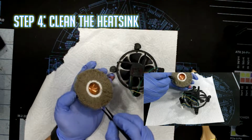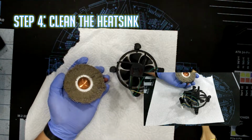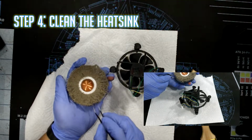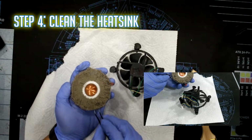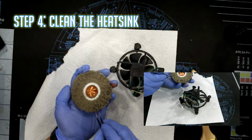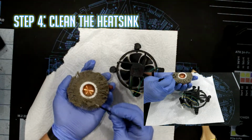Step 4. Clean the heatsink. First remove the dust with a brush or dry cloth, then treat it with compressed air, and then finish it off with a cloth and alcohol. And if you're wondering why I haven't dunked the heatsink in water, it's because dust is much harder to clean when it's wet. Plus, we don't have to wait for it to dry before mounting it back onto the motherboard.